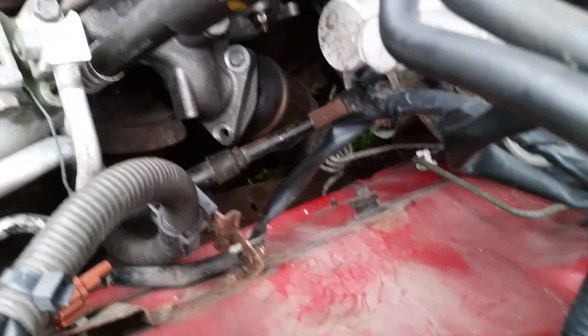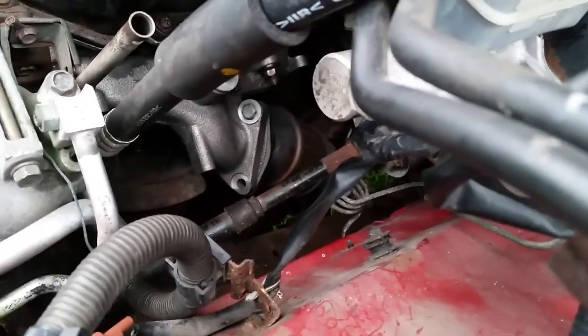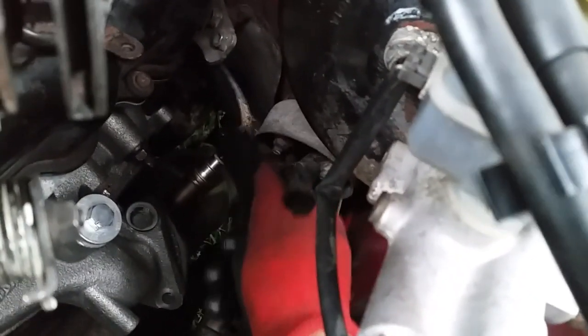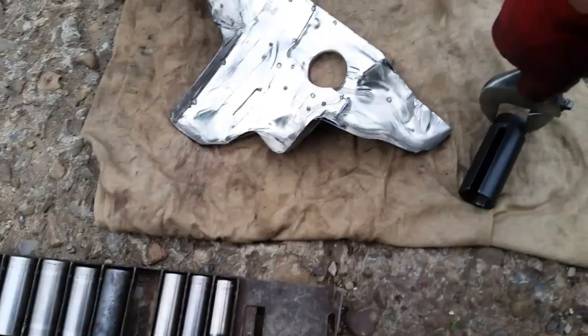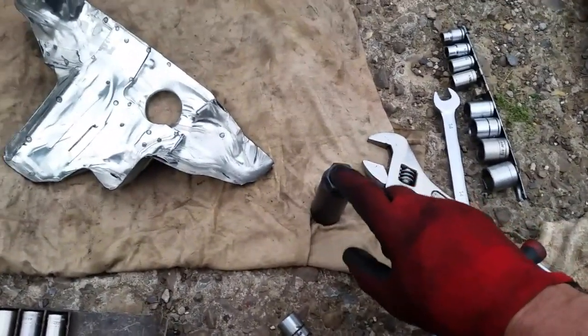This is how I did my manifold on this Xterra, especially on the driver's side. It seems like the driver's sides are always the ones going bad because there's an EGR tube over here - it may be a little more exhaust flow on this side. Lucky for me I don't have to worry about that EGR tube. One tip: for these aftermarket catalytic converters, the O2 sensor socket actually hits the steering linkage, so you have to use a thumb wrench to tighten it down.